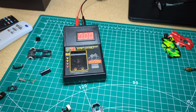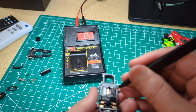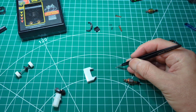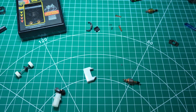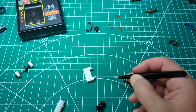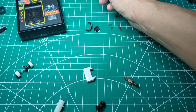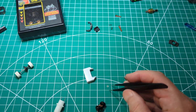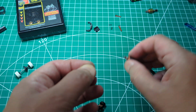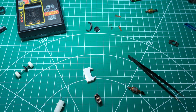Really hot. Interesting. I didn't check the, oh, I got a problem here with the spacing. I gotta check. Yeah, this is definitely too tight, so stand by. I didn't realize that I had a 0.1 spacer on my modified, and it was actually inside the end bell. And I also had the spacer that was on the armature, so we have to take this guy out of the equation and just put what it had when it was in the other chassis. I didn't see that it was stuck to the bushing in the end bell. So I'm gonna put this back together. We'll try that again.